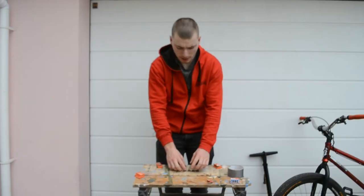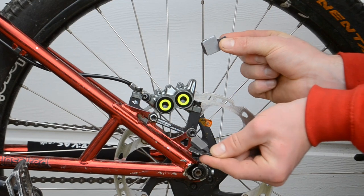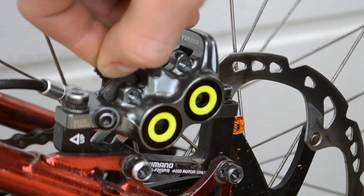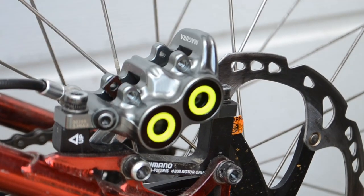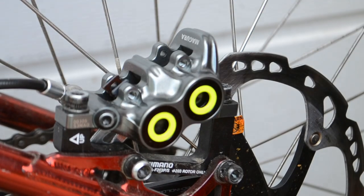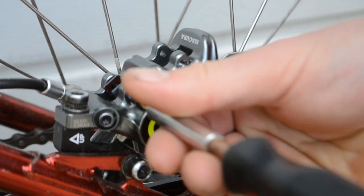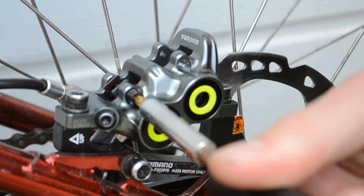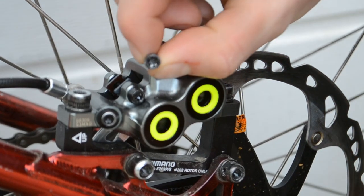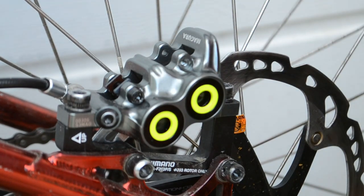We've got all four pads out of the caliper. What we're going to need is some duct tape and a razor blade. Now we've got all our duct-taped pads, it's time to refit them into the caliper. I'm going to try and slide them in without having to move the rear wheel because that's a bit of a faff with all the chain tensioners. We might have to wiggle this as we go in to get it to line up with the two holes, and we'll do this up using the T25 again. A lot of people try and use an allen key for these, but a T25 Torx bolt does require the correct tool.